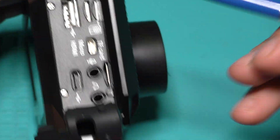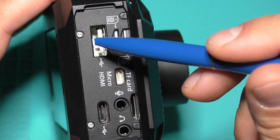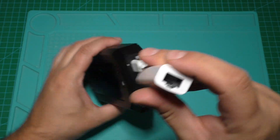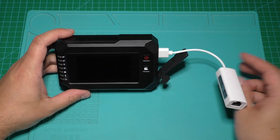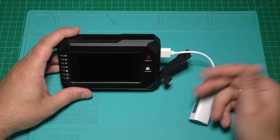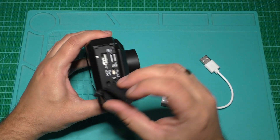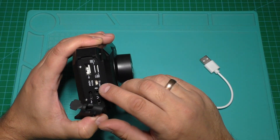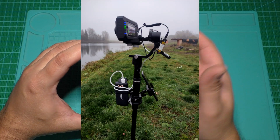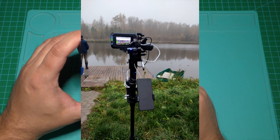This camera supports bonding with two SIM cards, Wi-Fi, and if needed you can connect a USB Ethernet adapter and an RJ45 Ethernet cable — giving you four internet sources, which the camera will bond into one streaming source. I tested this camera and for me two SIMs was enough, but for a more stable stream Wi-Fi is better. Three internet sources was enough for me for 4K streaming at 12 megabits.